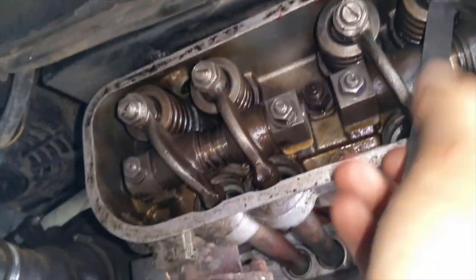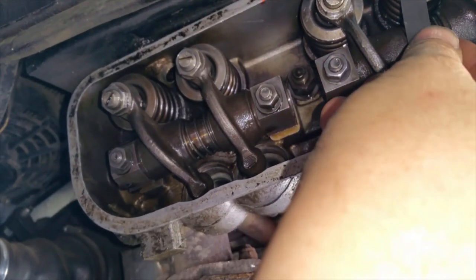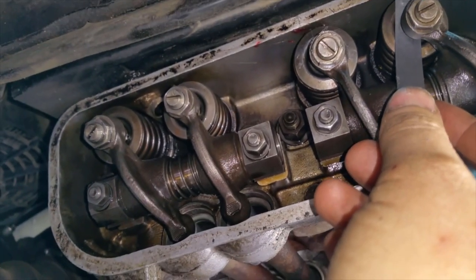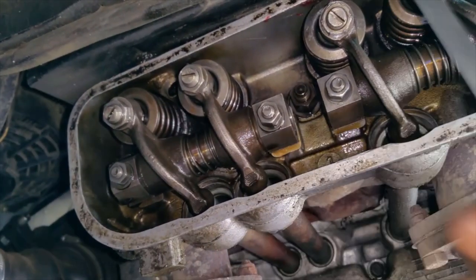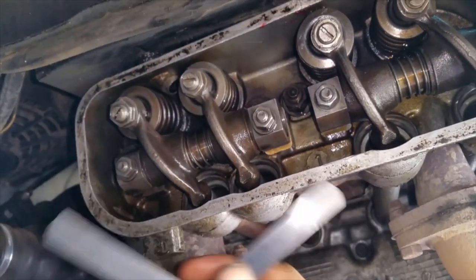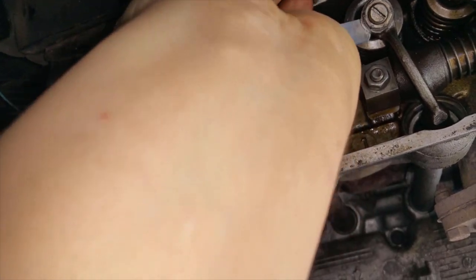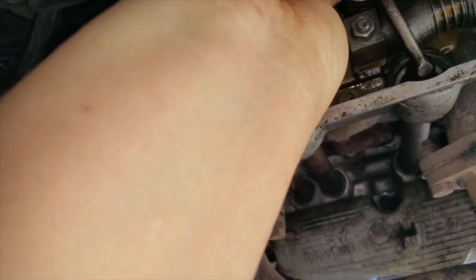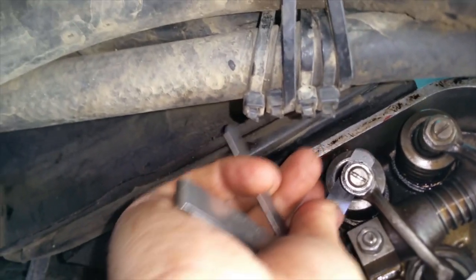Okay, muchachos, so I went ahead and installed everything up. And everything is exactly the same. That's it. This thing is dragging pretty good right here on the exhaust valve. The exhaust valve should be at 0.008 inches, and that's perfect. It didn't even change anything, so I didn't have to calibrate that again. Let me check this one. This one should be 0.005 inches, and there you go. Perfect. Look at that. Nothing changed. Everything's exactly the same.